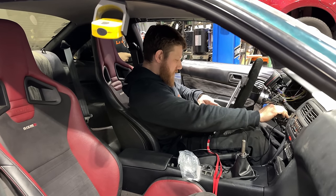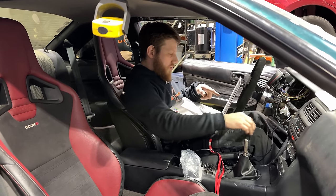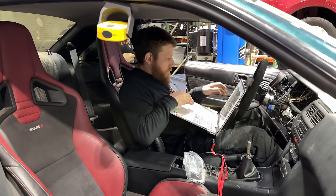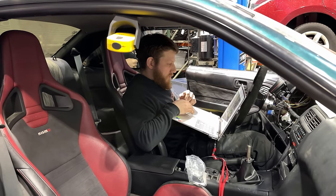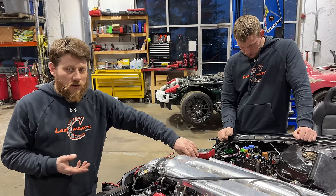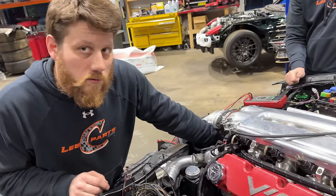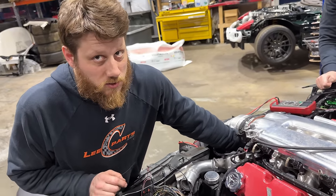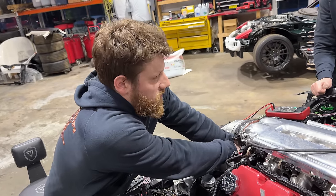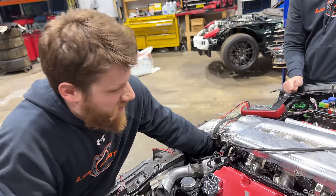No cam sync, and we're dropping out ignition on cylinders 6 and 7, but more importantly, no cam sync. All we did was unplug this and plug it back in, and then he pulled it up again and it read. That's a good point. So maybe another situation where it's just not reading because it's not in contact with the pins, and my little fingers can't unclip the connector.